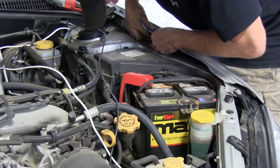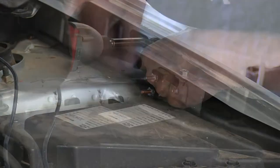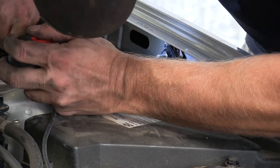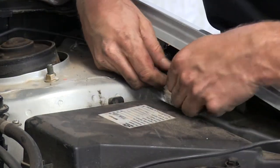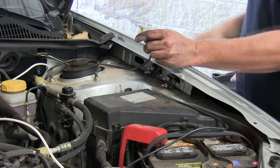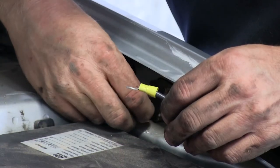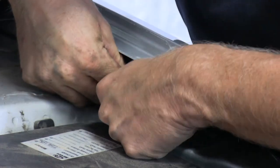Next, we'll mount our circuit breakers. We're going to mount a 40-amp circuit breaker for our black wire for the 12-volt power supply out back, and then add a 20-amp circuit breaker that we'll eventually use for our brake controller. When we connect our black wire to the 40-amp circuit breaker, we'll use two small ring terminals. The other end of the wire that continues to the battery will get a larger ring terminal, and we'll leave that connection for last. When running wires through the circuit breakers, the post with the copper goes to the battery, and the silver post goes out to the accessory, such as a 12-volt hot lead or the brake controller.